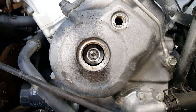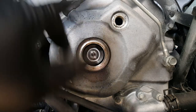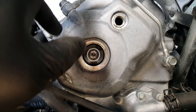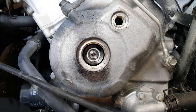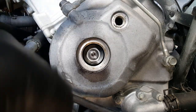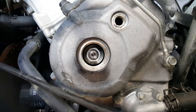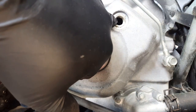Now, with a four-stroke engine, the crankshaft turns twice for one revolution of the camshaft. We need to get the camshaft in just the right position. It might be that when we rotate this and get the mark, we're actually 180 degrees out on the camshaft, and we'll need to turn the crank another full revolution and then back to the mark again to get the clearance. I'm going to start turning that and you'll be looking through this little window.